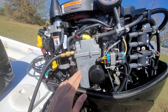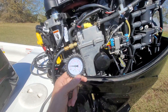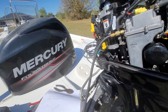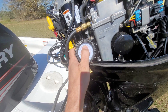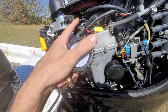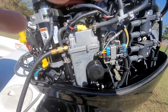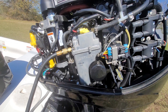On the high pressure side of this fuel system, here's your tap right here. When it's running you should be seeing over 40 psi — like 42 to 44 psi. If it shoots up to 40 and then when you shut it off you lose all your pressure right away, it's most likely your fuel pressure regulator letting all the pressure bypass. That's a quick overview of this system, how it works, and some ways to test it that I wasn't able to find easily. Hope that helps.